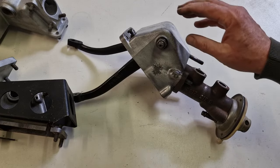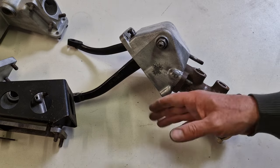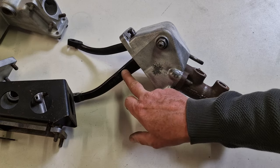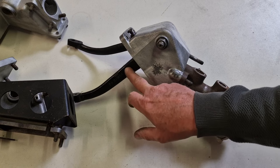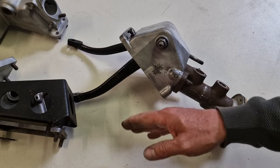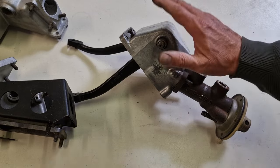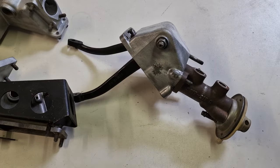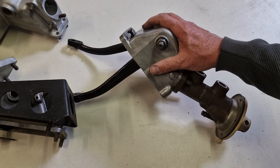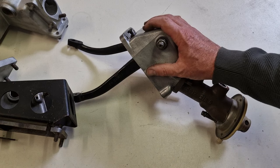This was good also for the automatic. Just the clutch pedal was missing, and it was a different pedal. And also the pedal arms were all different for left-hand and right-hand drive. They had a different angle, and you can imagine you had the tunnel on the side or in the center, and you always had to get away from the tunnel. So just be aware, there are 1, 2, 3, 4 different pedal boxes. The clutch and the manual for the later cars are the same, there's no difference, but the components have to fit together and you have to get the right parts for your car.